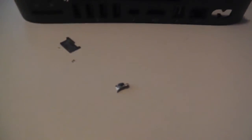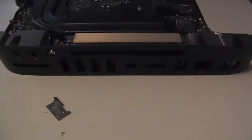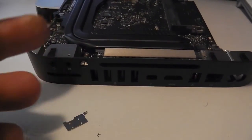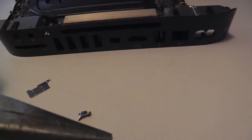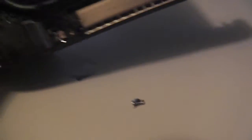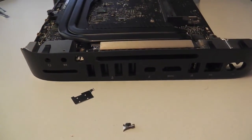I was actually kind of surprised to find a second layer of the shielding, and that piece was a little more difficult. It wasn't just held on by the little nubs and that one tab — I just had to break and snip that off, and that piece was done. But the underlying shielding that was there, I had to take some needle nose pliers and rock it back and forth and create so much fatigue on it. Finally, after 100 times back and forth, it finally did break off. You can see I scuffed it up a little inside there, but nothing bad. I think the hole is in the right place, so I'll go ahead and shoehorn the pigtail in there and show you what it looks like.